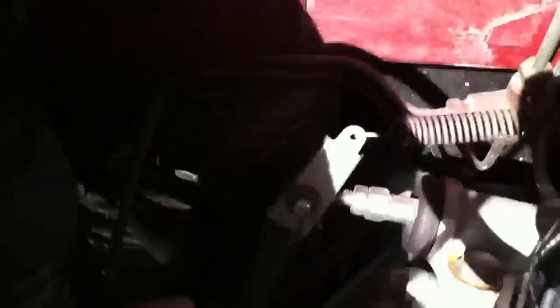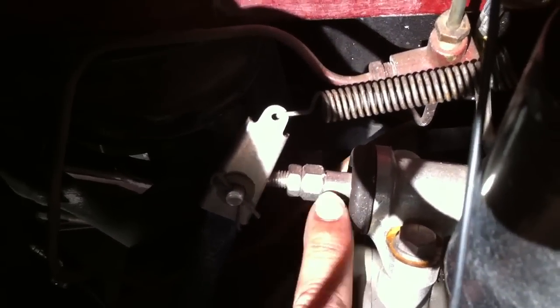I'll just kind of line it up. It went to my stabilizer bar — I've got this adjustable bar, although really most of these end up being all the way in to be the standard length. Don't think that you'll be able to move the engine around much; it'll have to be all the way in to keep stuff from hitting the grill up here. I do have this also — this adjustable slave push rod, which is nice because a lot of times these parts down in here, sometimes this clevis gets a bit worn out.